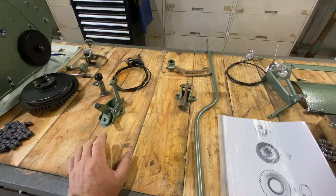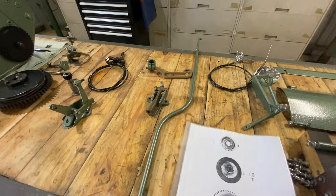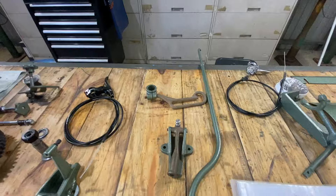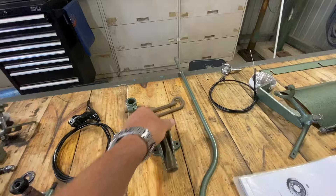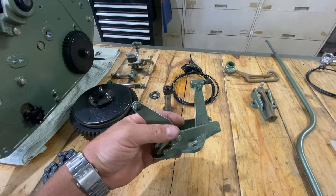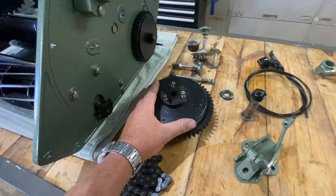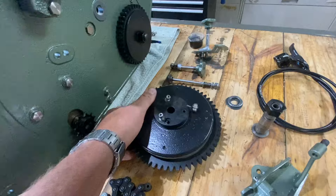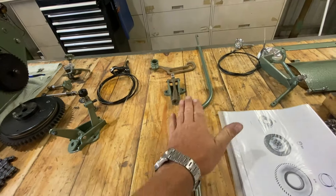If you've been following along you'll already be familiar with what I'm about to say, but we'll dive into a little bit more detail about what's actually going on with this clutch. For anyone familiar with the Supercut, this is the run-of-the-mill drive clutch and how it's activated. We're doing away with this system and going down a different path with this modified piece. On a Supercut the clutch is normally engaged and held together with spring pressure, and from there you would disengage it with this lever.